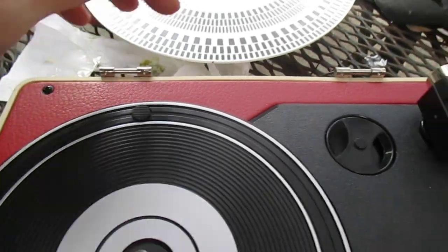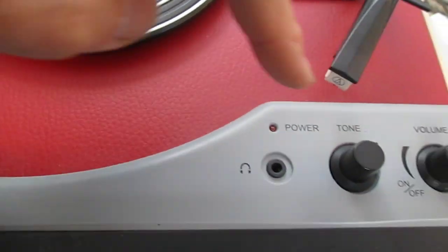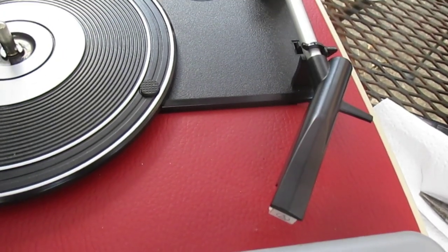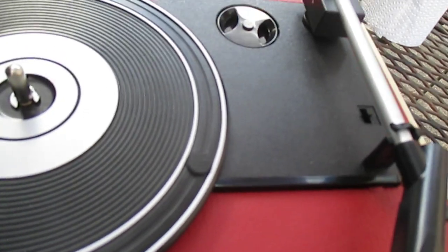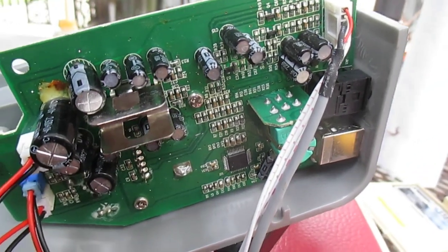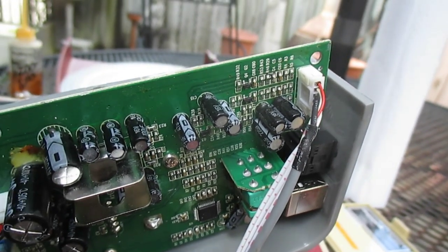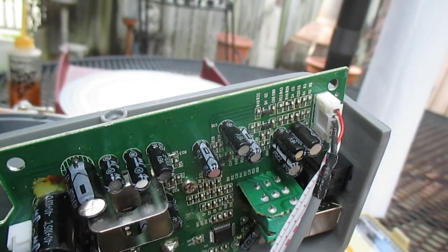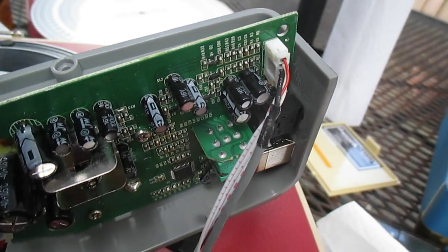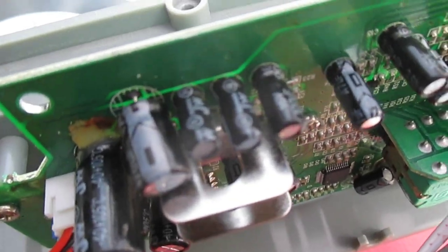To get this apart, remove the two screws at the rear of the motor board, then the two screws holding the gray piece, slide that back, then two more screws on the front of the motor board to lift it off. The sticker says from 2012, 'Caution — risk of electric shock, do not open.' Challenge accepted, because the maximum voltage in here is 12 volts. Here's the amplifier board — the majority of the circuitry is probably for USB capability. The older tube and through-hole solid-state stuff has the advantage: you can actually repair that with off-the-shelf parts. This crap is really not meant to be repaired.